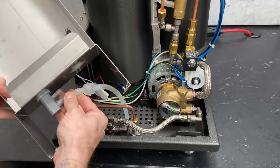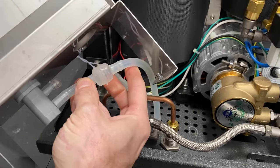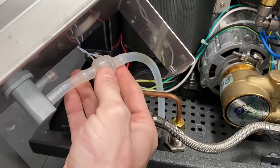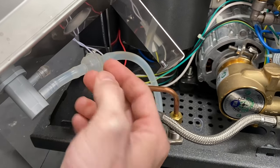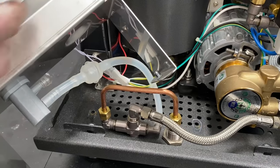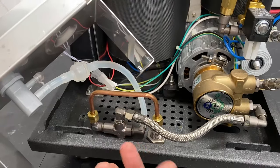On the bottom here, you'll see another silicone line, and in the middle of that is your inline filter. This has a very fine screen in the middle of it. So when the water comes through, if you have some coffee grounds or something that got into your reservoir, this is going to catch it so it doesn't go too far into your system.